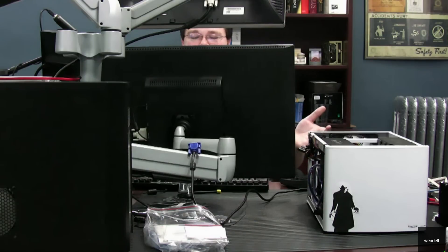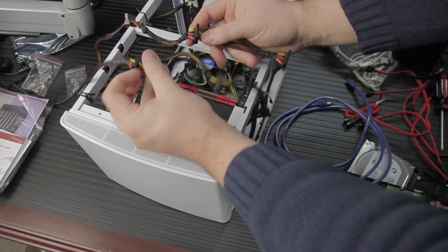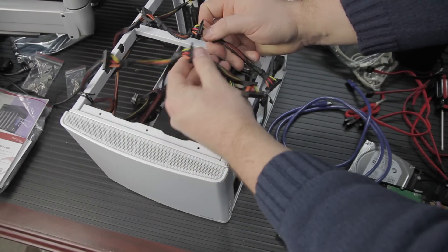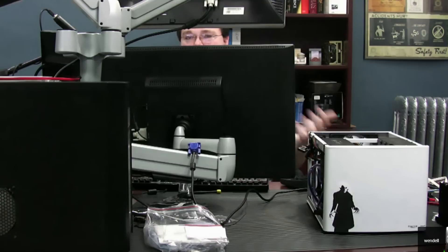The other thing I like about this case is it fits a standard ATX power supply, even though it's tiny, so I can run a lot of power-hungry drives. With the FreeNAS Jails functionality, which lets you run other operating systems, there's a version of Debian that will run inside a FreeBSD jail with the FreeBSD kernel — which is sort of an unholy abomination, hence NASferatu — but you can do it. You can also run a Plex Media server and a whole bunch of other plug-ins.